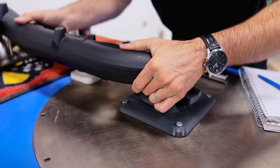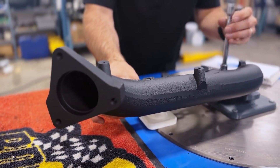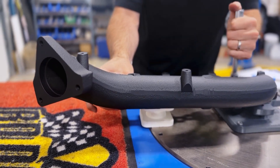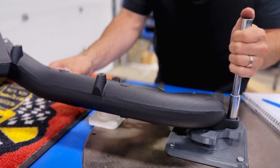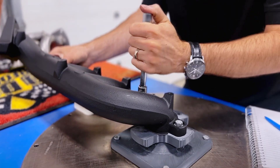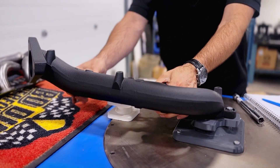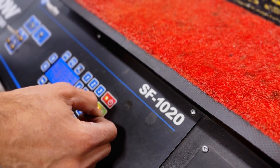The big cast iron boy is heavy. In the vehicle, the BD manifold would be installed with longer fasteners and spacers to help aid the clamping and to reduce the chances of breaking the fastener, which on these manifolds is one of the common problems — busting the fastener. I think a lot of you Chevy half-ton guys know about the fastener that's on there at the back of the motor near the firewall.